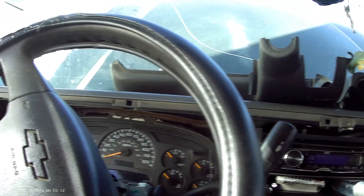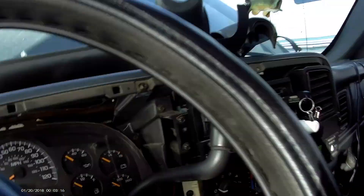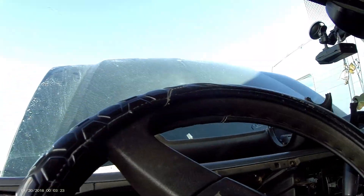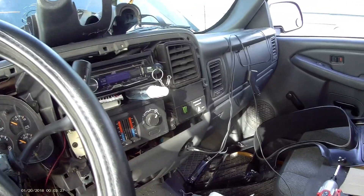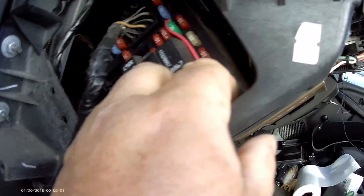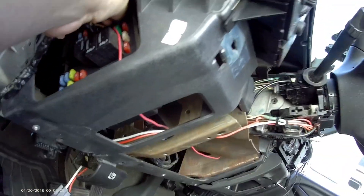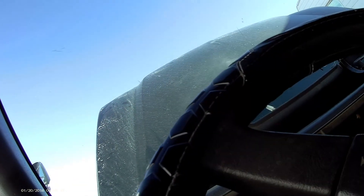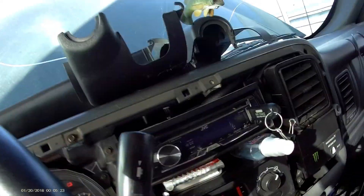Now I'm gonna work on my stereo here. The only time it comes on is when the key's on. But I think this wire right here runs to the fuse box — it's the main hot wire. So we're gonna get into that here in a minute. I'll zip tie that up, clean it up a little bit. This red wire right here goes over to the stereo. So what I'm gonna do is just pull that fuse out, take the wire out, put the fuse back, and by some chance we'll see if the stereo works. It shouldn't — I wouldn't think. Nothing. Bam!